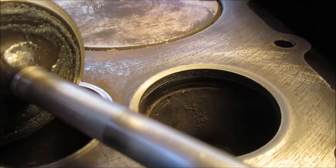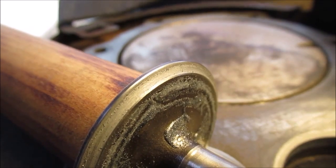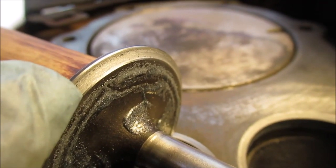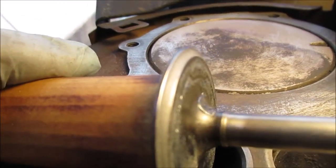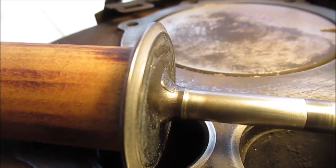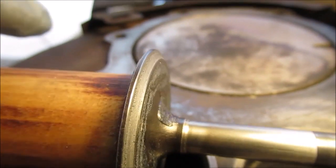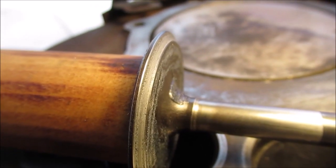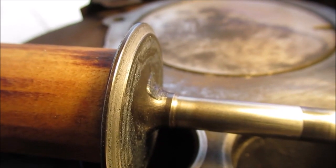Can you see the gray between there? You see the gray on there - that's where it is sealing. So it is sealing between the two shiny spots. I said this valve should be cut because this lip, in my opinion, could keep the valve from shutting tight - because it's bigger, you know what I mean. I don't think we can get the angle that we want. I need to put the piece of cardboard back to block that light from the house. It's a cloudy day but I need to block that blinding light.